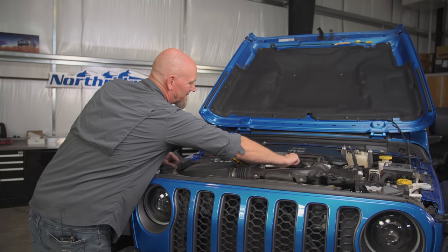All we have left to do is prime the engine with oil and start it up. Here is the Jeep engine oil priming method: put both feet on the pedals — one on the gas pedal, one on the brake — push them both down, then hit the start button. The engine's going to start turning over and it's not going to stop until we take our feet off the pedals and then hit that start button again. Hold for four to five seconds, then release and hit the button — do that twice. The engine is now primed, so now we can start it as normal. If you have a clutch, foot on the gas and foot on the clutch. If you have a key instead of a push button, you're going to be turning that key on and off.